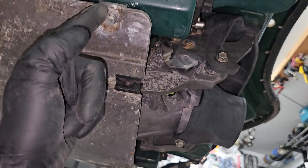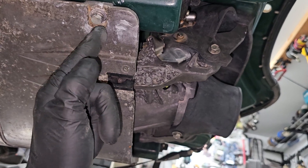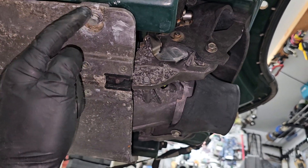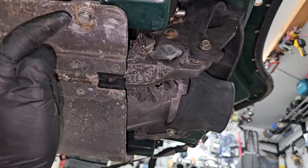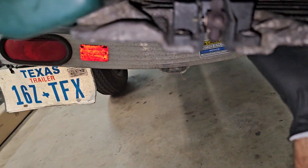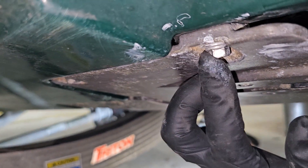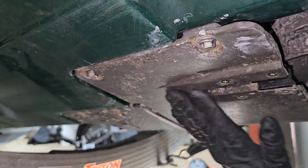What I'm going to do is torque these down to spec, put a black line showing direction on there, remove them, and grind these bolts down on that side as much as I can tolerate without losing the ability to remove them. It's going to be pretty close — a little bit sketchy maybe — so I may rethink that maneuver.